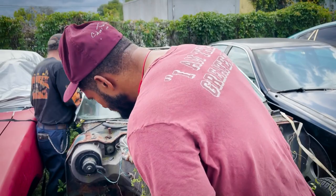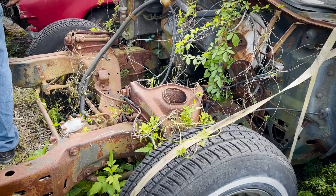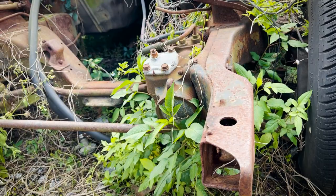We're still gonna have to lift it up off of the frame to get a true inspection of it. But just from the front part of it, the surface rust, we could send that in. Once Mr. Rich disassembles the whole frame, we could send the frame in, get it stripped and prepped almost as if he was gonna powder coat it. Don't powder coat it, we'll get it back, put it in etching primer, and then go from there.